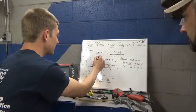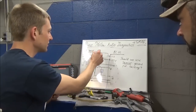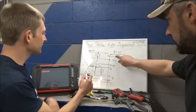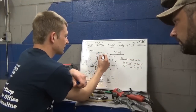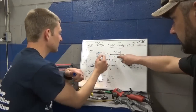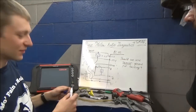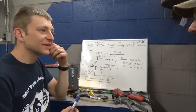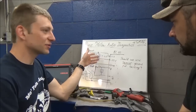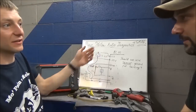Now let's go back to signal wire to battery ground. What would you see now? Now you're going to see your 2.5 to 3.5 - you're seeing the difference of the bias voltage. Don't be scared of your bias voltage - you can still do your checks. One of them will just be offset.